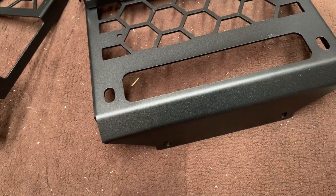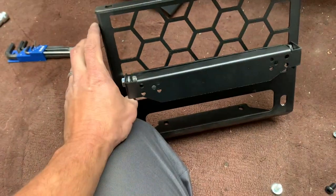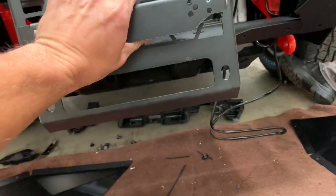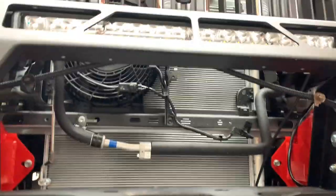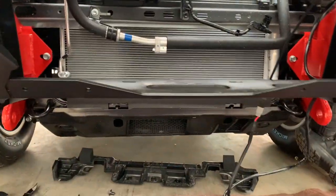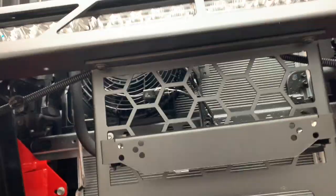Two M6s. Being a brand new car, we don't actually have a number plate so we'll leave it for the dealer to put on. Now put this up on the bar with two M8 hex nuts from the bottom up, and a button head cap screw underneath. Put the middle one on first — need two hands so can't do it on camera. Got the center one on — M8 button head cap screws.